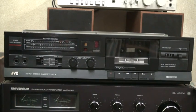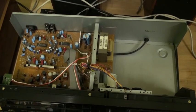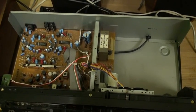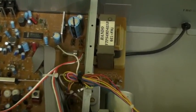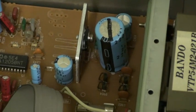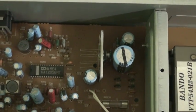Now let's go ahead and have a look inside. Of course, it got a lot worse in the 90s. This is the pretty much average mid-80s cassette deck — the kind of stuff that you got when you wanted to have a cassette deck but didn't want to spend a lot of money. The circuit board doesn't fill the housing anymore. The transformer is rather small. Same as for the power supply. That transistor would be happy if you gave it a bigger heatsink — as a matter of fact, there is a bigger one drawn on the circuit board, so that was a little bit of cost-cutting going on.